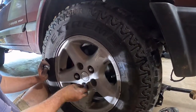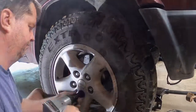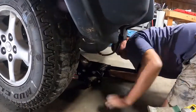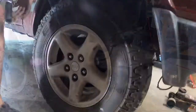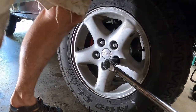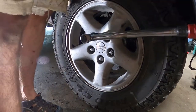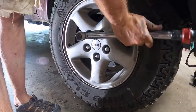With the caliper installed and the caliper bolt torqued, we can now put the wheel back on and snug up the wheel nuts. All that's left to do is to torque down the wheel nuts. My book gives a value of 75 foot-pounds, and remember that star pattern — torque one bolt, skip one bolt, torque one bolt, until they are all torqued down.